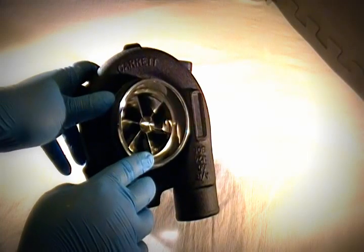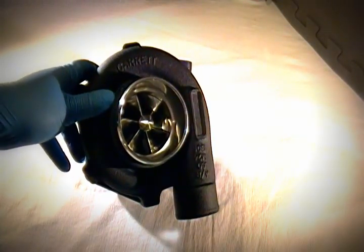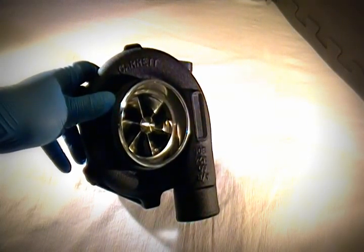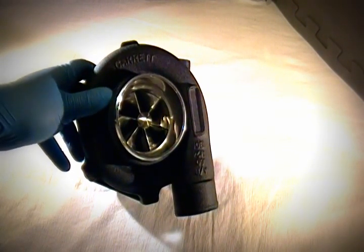With this new wheel, we were able to improve the effective range from 14 PSI to about 29 PSI, and really helped with responsiveness by about another 100 RPM. We're looking at maximum boost pressure under 20 pounds of boost for most 4-cylinder and 6-cylinder applications by about 3,800 to 4,000 RPM, which is actually pretty good for a journal-bearing turbo.